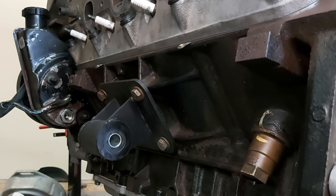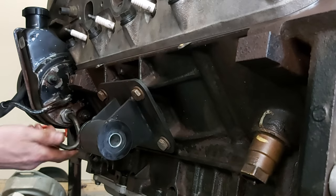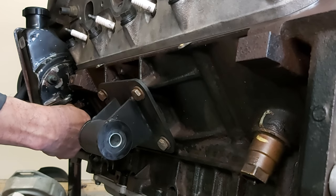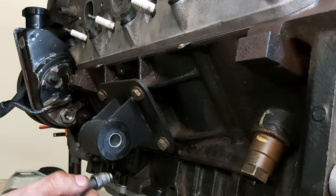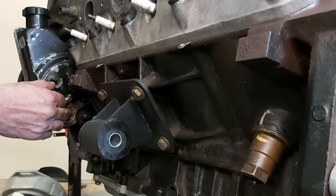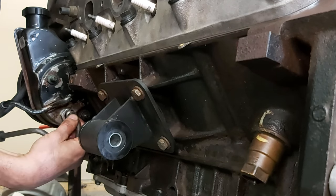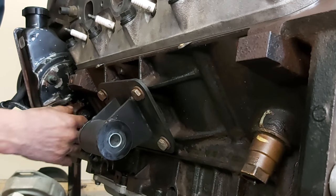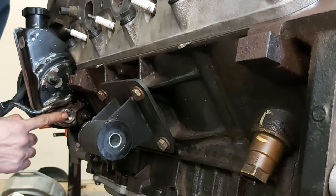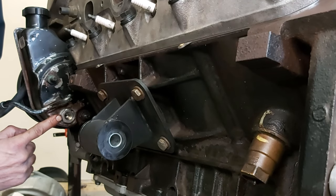Okay, that's snug. I'm not using the factory fitting because I've got to order some hoses that convert — basically it has to go to a Mustang rack and pinion. So there's no point even putting this in because the way the engine faces I can just get a straight one that goes right back to the rack high pressure inlet, since this was designed for your factory truck gearbox. So we don't need this, but again this is now done with the three shims in there — it's only putting out a thousand PSI, so we can use it with our factory rack and pinion on the Mustang or any Fox body.